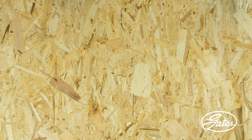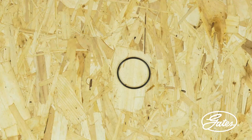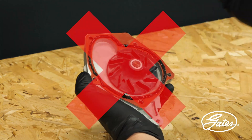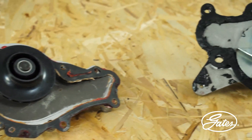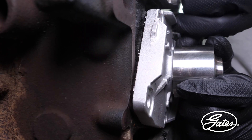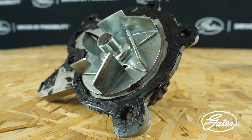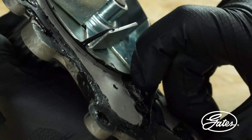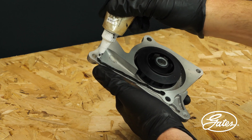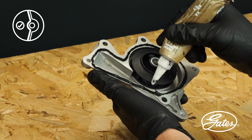The water pump can be supplied with a paper gasket, metal gasket, composite gasket or rubber seal. If a gasket or seal is included in the kit, it is totally forbidden to use additional sealant. Additional sealant on top of the gasket or rubber seal will create an excess that will spread through the water pump and side impeller and be sucked into the mechanical seal. Some water pumps are not supplied with any gasket or seal. In that case, please make sure that the sealant is being added in the correct way.